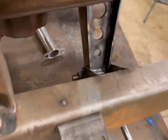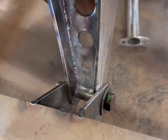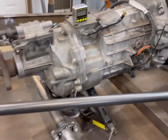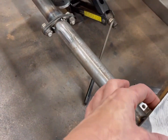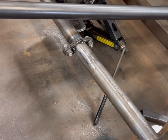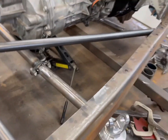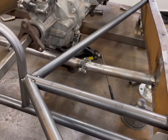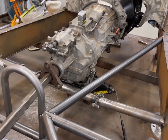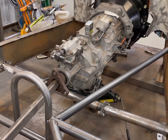Moving along — as you saw in the last clip, I was working on the motor mounts. We've repositioned those for the correct driveline angles. As you can see, they're tacked in. I just flipped them over and that worked out really, really well. Moving to the back here, the crossmember — which used to be up here — you can see it dropped down about seven inches. Just moving it to the bottom of the rail. Looking at it from the back, it does angle down toward the removable part of the crossmember, and it seemed to work out really well. So the driveline is now set.